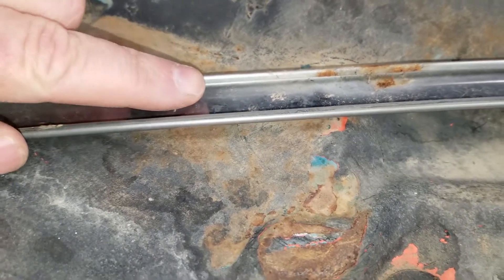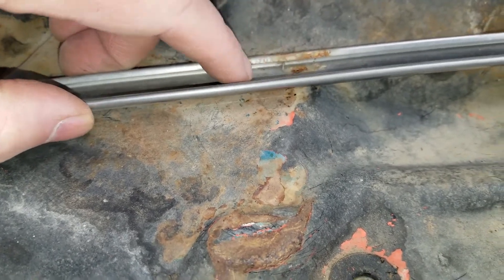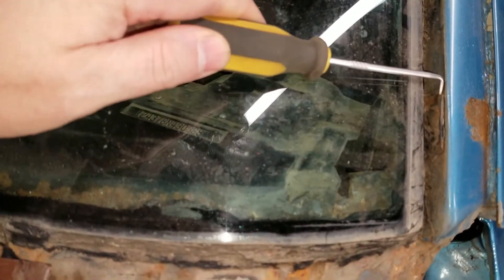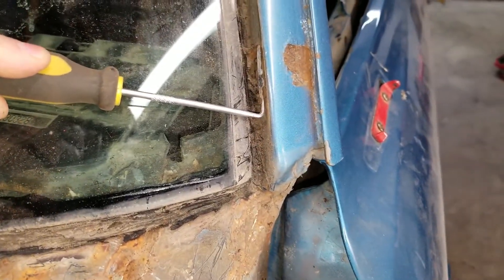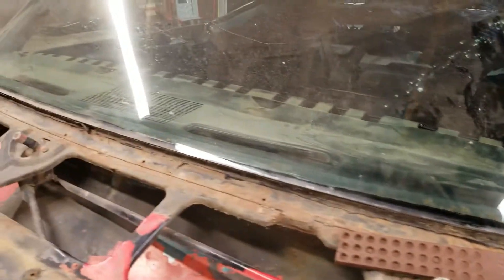Take a look at this edge — it's got a little bit of a lip on the inside of it and the clip just hooks right into that lip. You can see the rusted area where it was latched. What I've been doing is taking a little plastic shim and sliding it underneath to pry it away from the windshield, then going in with my hook tool and gently pulling that clip inward a little bit. That allows the trim piece to release and come out. I've done this side; I'm going to do the other side and then the top, and then I can look at cutting the windshield out.